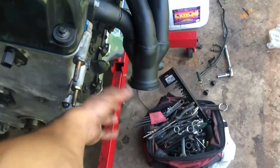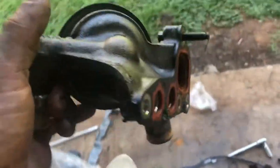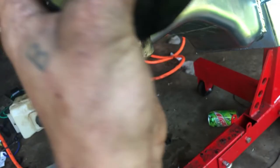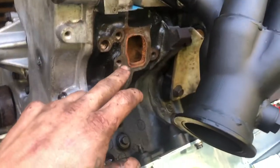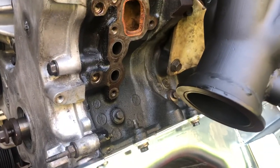There are a couple things I still need to get. The oil cooler — where the lower radiator hose is and where the oil filter would normally bolt on — I have to get a Mustang-style one. This is the one I have right now. The way it bolts on is like that, but the Mustang version is 90 degrees. That one is not 90, so it does weird stuff with the radiator hose. Even with either style, the oil filter will hit the manifold right here.